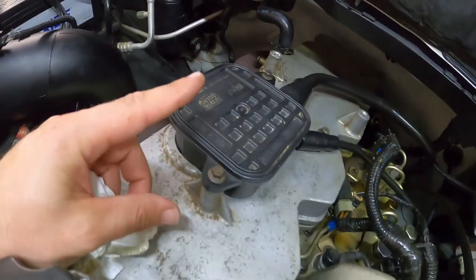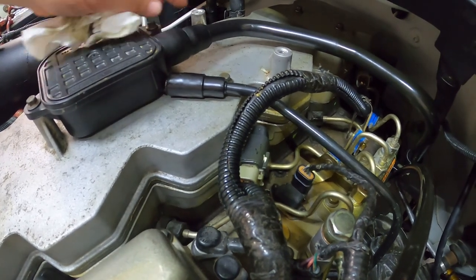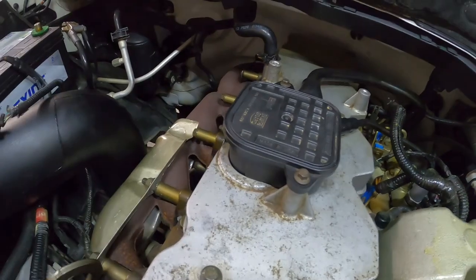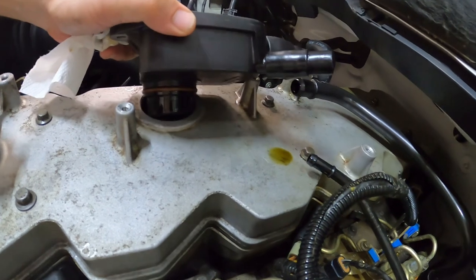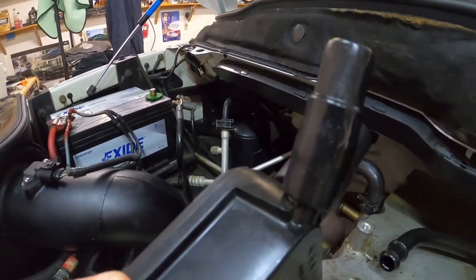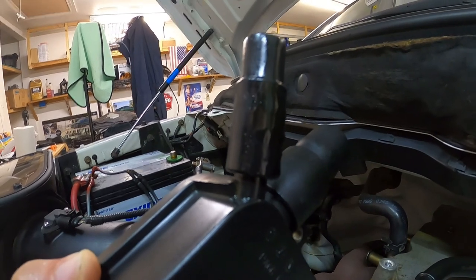It's held on by a couple of fasteners, so I'm going to undo that. To get these hoses out, all you do is just pull on them — these can be a little stuck. This actually goes into the valve cover; there's an O-ring under this. So I already lifted this up just a little bit, and look — there is a puddle of oil right there. That did not come out of the hose; I watched it as I took it apart. You can see it dripping right at the bottom of that connection, right on that little coupler. There is definitely some oil going on there, so it looks like I found my leak.